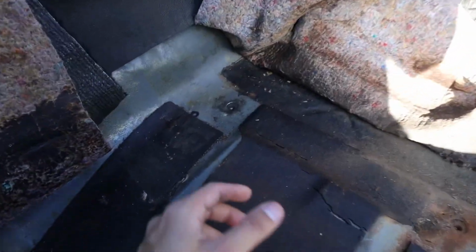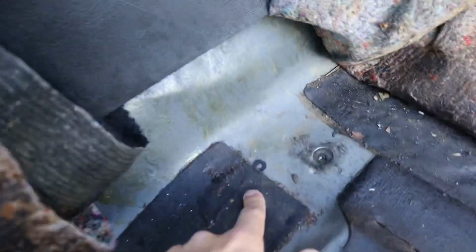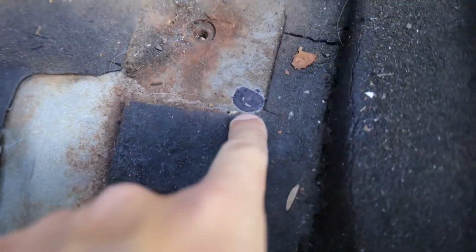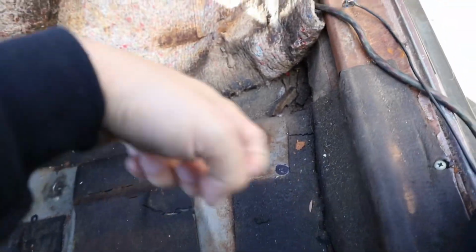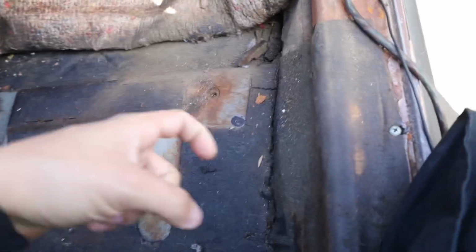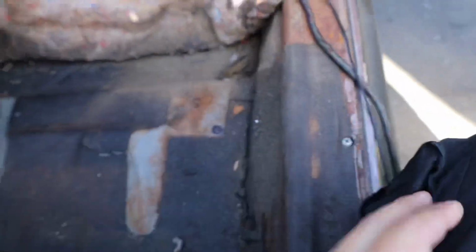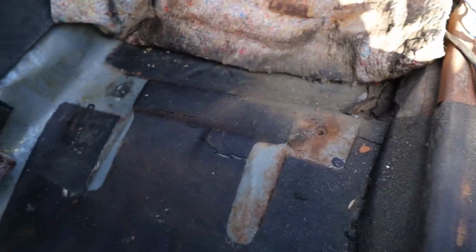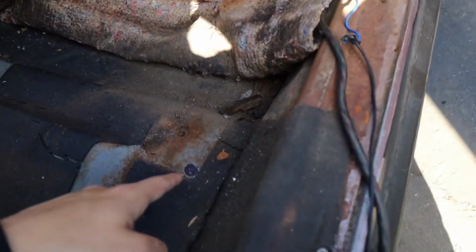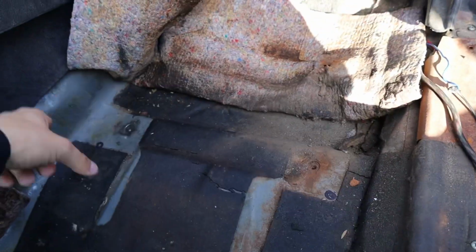Alright guys, so I got it lined up like the other seat. I circled the little hole here and here. Now what I'm gonna do is tap both right in the center, so the drill doesn't start sliding around when I start drilling the holes through. Make sure that if you're gonna be doing it the same way and drilling through, there's nothing underneath the car, like a brake line or a fuel line, so you don't go through it by accident and mess something else up. Beto's hooking up the drill right now, and I'm about to drill through these to make our first two mounting holes.